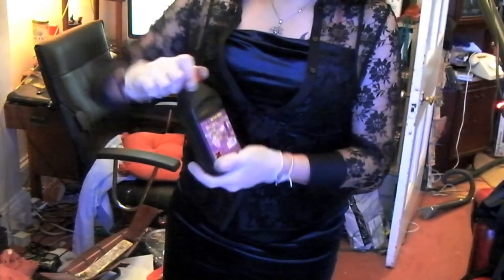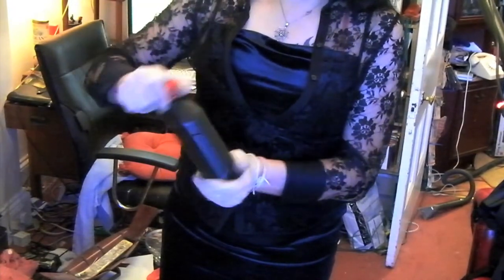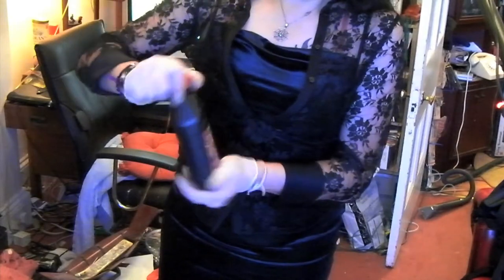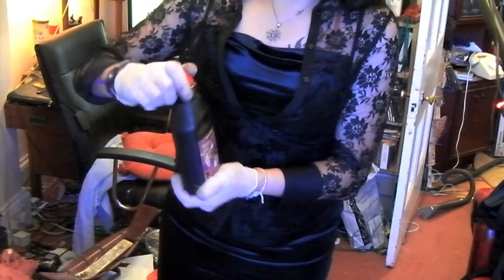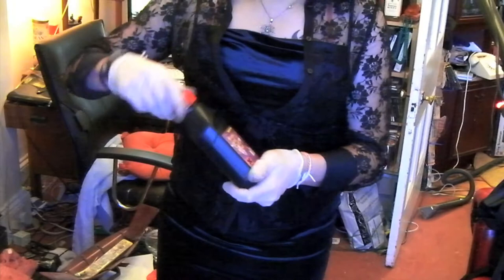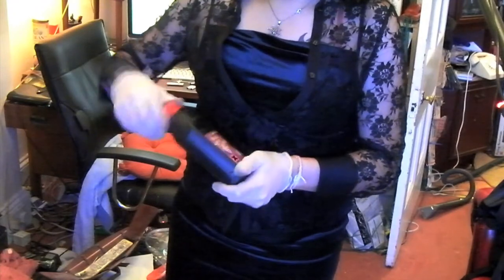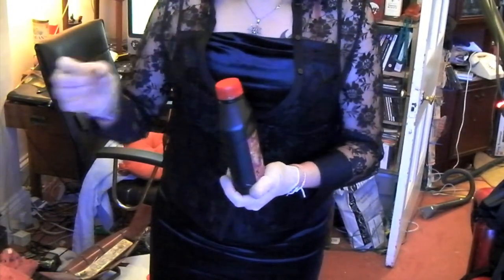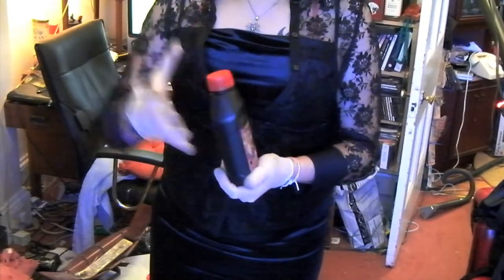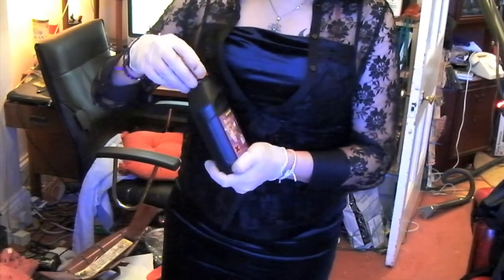It's from a sealed bottle, of course. Is it hygroscopic? Yes. It is a sealed bottle, as you can see, and underneath here you'll find a nice foil lid. Carol is correct - this is hygroscopic. The material absorbs moisture, which reduces its effectiveness as a braking fluid. It works by being under pressure, pushing the pistons, which then push the pads against the discs. If it's got water in it, it changes the boiling point of the fluid, which can effectively lock your brakes on. Not good.